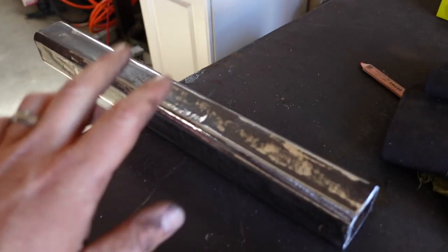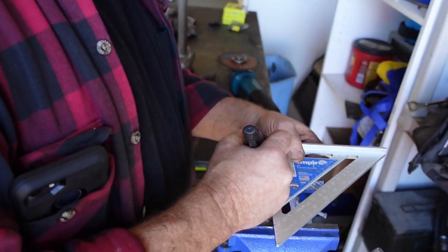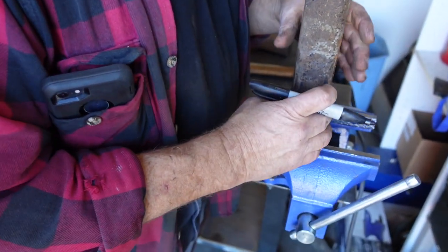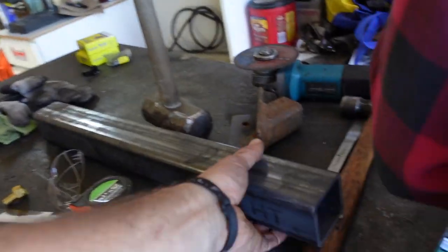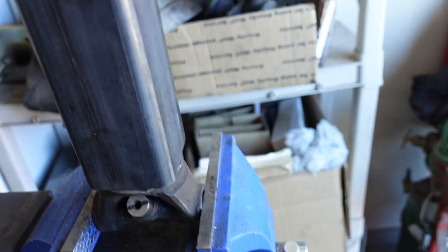All right, this is moving right along already. So I got my 2 inch cut and kind of cleaned up. Dad got the driveline all torn apart, so now he is marking out the 2.5 inch, I believe, right now. So yeah, we'll just trace the outside of that 2 inch, and that'll be the inside of the 2.5. Just whittle away at that metal. One yoke down.